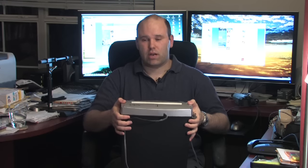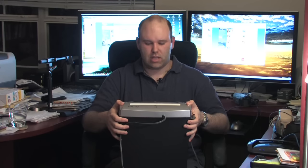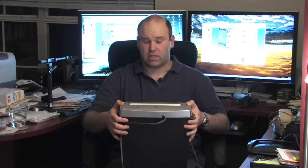In the case of a paper shredder, unplugging the device is handy because it might be that the motors are just running hot. You may have just shredded a ton of stuff and the motor just needs a break. So unplug it, let it sit for about an hour, let it cool down, and then try it again and see if it works.